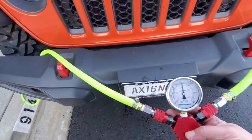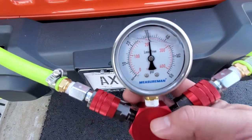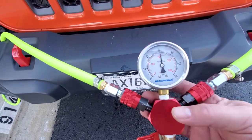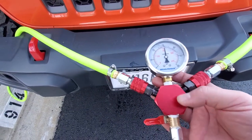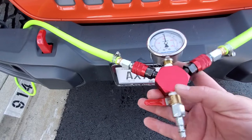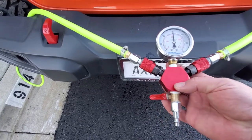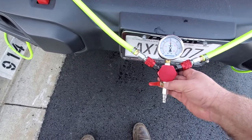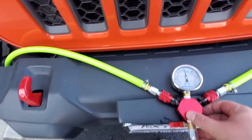It all comes over to my manifold. I looked around a lot — I wanted a glycerin-filled lead-free gauge. I'll post the link below on Amazon. It comes in from both sides. This had another air chuck on it, so I took that air chuck off and I took the air fitting that came factory with it and put this shutoff valve on it. To get that air chuck off, I had to put it in a vise and lock it down — they were in there, wow were they tight.